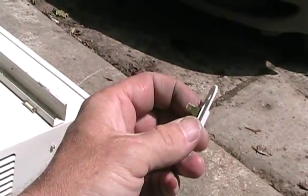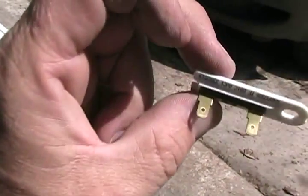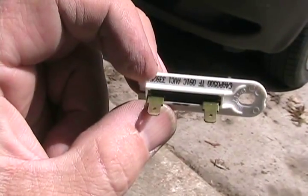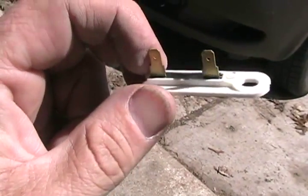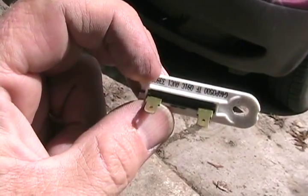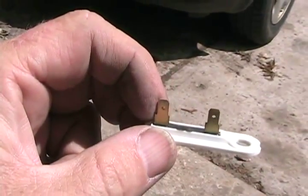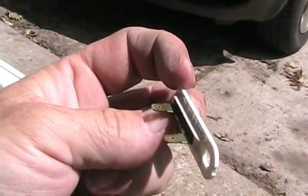If you happen to have a Kenmore, Inglis, Whirlpool, or Roper dryer made since the 1990s, they might have one of these thermal overload fuse things. If they get too hot or too much current goes through them, they shut off the motor. So if your dryer doesn't work, it either has a broken belt — which also shuts off a switch — or this thing at the back of the dryer near the bottom left when you remove the big access panel. You can't tell if they're good or bad, but if you test them with your meter, or temporarily join the wires together with some tape, plug it back in, and your motor comes back to life — just buy one of these little $5 parts.